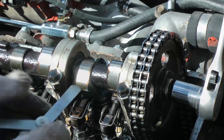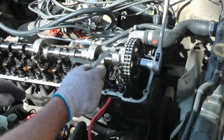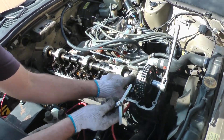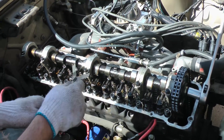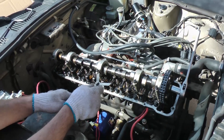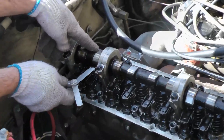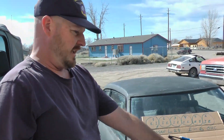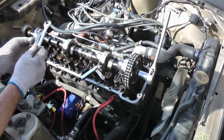See how that's tight right there — the feeler gauge won't go in. That valve needs adjustment; that rocker arm needs adjustment to get proper clearance, and that's why the engine could be running so much better. Number one exhaust, number two intake — look at that, won't go in. So the valves are way off adjustment. Number six intake won't even go in. Just goes to show you they mix and match as you adjust the cam, so we check them off as we go.